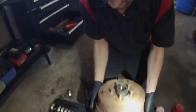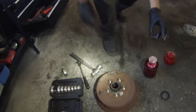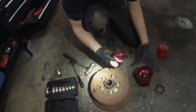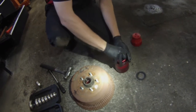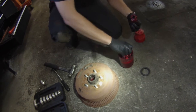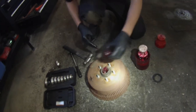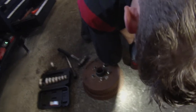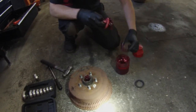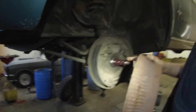And we're just going to do a little bit of grease around the lip of the seal. That is your inner bearing done. Now we can simply do a repack on your outer bearing. Put a little new grease down inside the middle there — that definitely doesn't hurt. Also put a bunch of grease on your spindle as well.